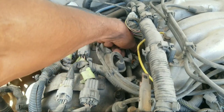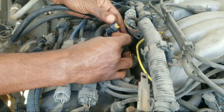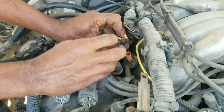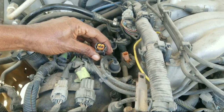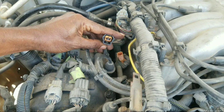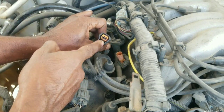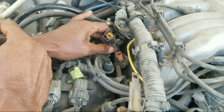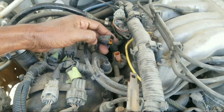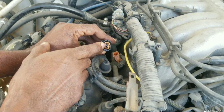The next thing to do is disconnect the plug from the injector. When you press the pin, don't pull on the wire — the wire can become broken and disconnected inside. Get an LED test light or a fuel injector test light and plug it into this pin. Then go and crank the engine. While cranking, look at the test light to make sure it's flashing — this tells you the ECU is commanding the injector to open for spraying fuel. Once you notice an electrical pulse at the injector plug with the test light, it means the ECU is in good condition.